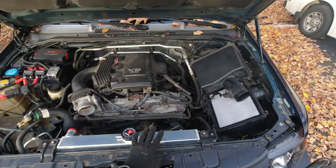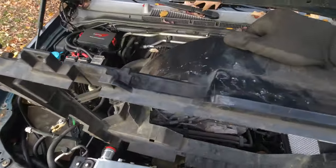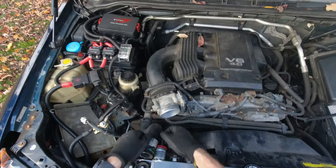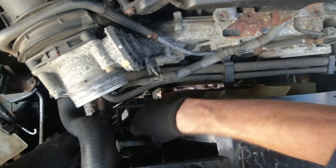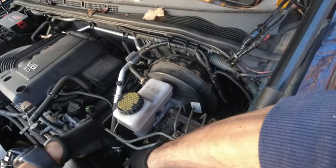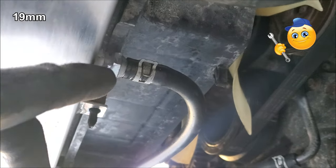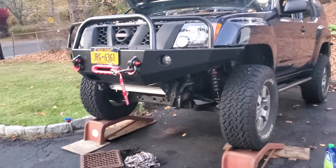After a little bit of wiggling, the new radiator is in. Now it's time to put the fan and shroud in — first we're gonna slide the shroud inside, then slide the fan inside. Now let's get our overflow hose in place, connect our top hose, and that is in place as well. Don't forget to connect the cable for the fan. Let's put the airbox back in place and mount the air intake as well.